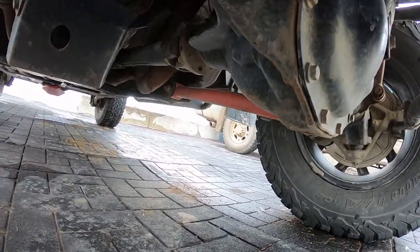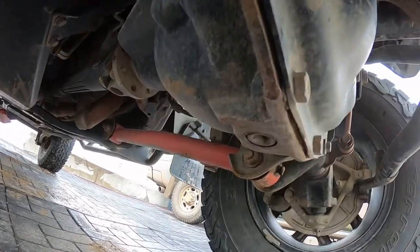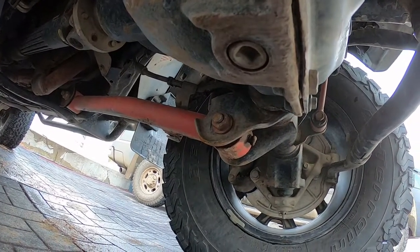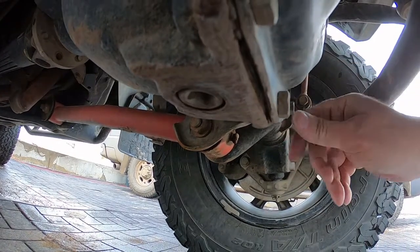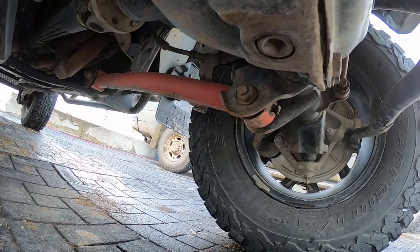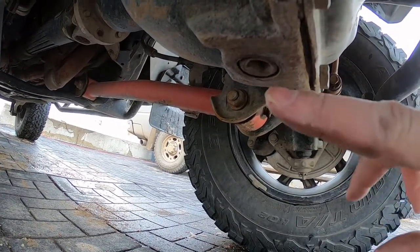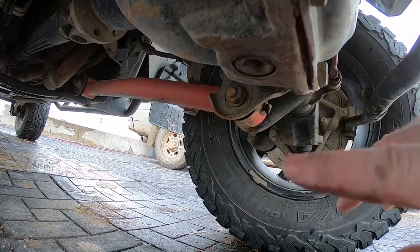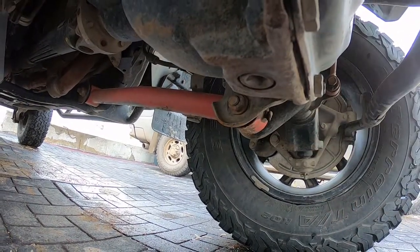In my earlier videos, I went to the Rubicon Trail. We did get caught with that drain plug issue. Just an update: I got the new plug and I ran a 1/2 inch MPT tap up after I pulled my cover, and now this is countersunk.